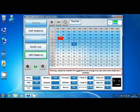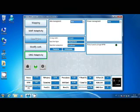Okay, let's go further on the gas petrol tab here. We need to activate the express section. So we'll see here that we have a selectable number of cycles in the anticipate section. This number means how many engine cycles we should anticipate when we use this feature. On a 4-cylinder car, like this one, you can anticipate a maximum of 3 cycles.